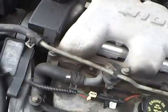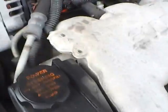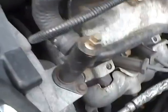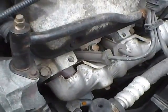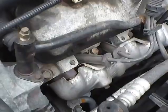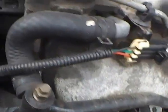I tightened these down a little over a turn, or near a turn. The other two bolts are at a 45 degree angle going into the heads — one on the front head, one on the back head. Now the trickiest one is right down underneath the power steering pump.